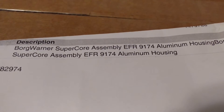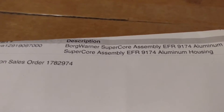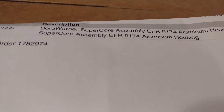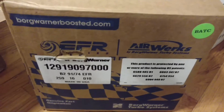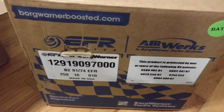I went with a Supercore aluminum housing. What do I plan on doing? It's a Series 5 RX-7 motor. I'm going to take a Series 5 turbine housing mated with GPOP shop machining and ceramic, and then we're going to mate this to a Series 5 manifold. The A over R ratio is 1.0 on that.